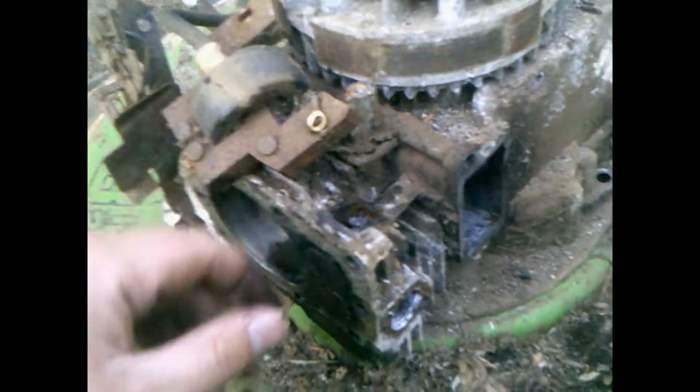So I sprayed WD-40 down in there, and then of course, you rotate it till it's released, and you can usually check that. You can move the lifter back, push the lifter back. And of course, the valve was here, and there you could see the gap. And then I tapped on it lightly with the plastic hammer, got it to go back in, but it's not seated all the way in yet.